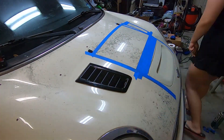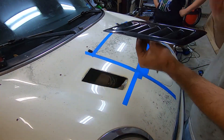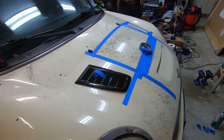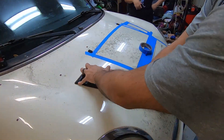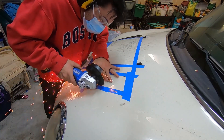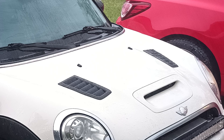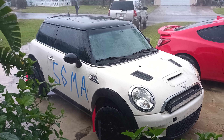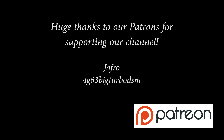I've looped a piece of painter's tape around sort of in the vent and out to let me get a good grip on it and place it in with a little bit of tension. Now we'll move to the other side and hope it's going to be symmetric. I did not wear a mask on the previous cuts, but I highly recommend doing it — I got a lot of that dust and grit in my lungs and in my nose and it caused a lot of irritation for a few days. Here is the finished product of those hood vents and I think they look great. Make sure to stay safe and be healthy — and of course, keep modding your cars.